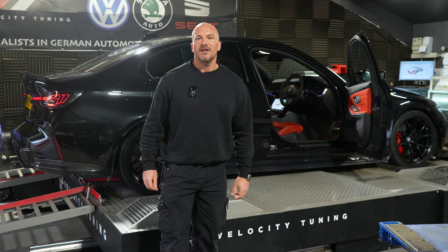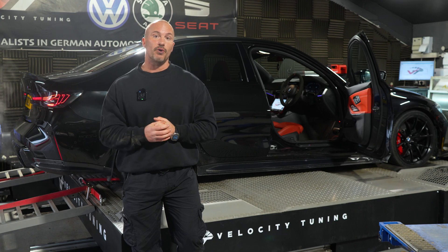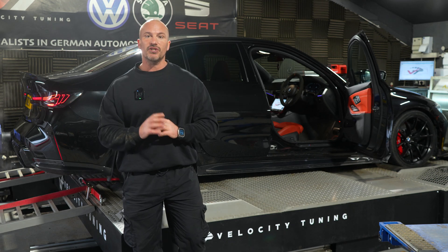Also, this will give us an increase in power without making any changes on the ECU, but by having better fueling we can push the ignition further, and we're not going to get a drop in fuel pressure — meaning we can also run more boost if we wish, and that's how we're going to find that extra 100 brake. Back over to the big PC now to start the meth mapping. We're going to use map one and copy it into map slot two, then make a couple of changes — increase boost slightly, give it a little more ignition, keep the fuel target where it is, and turn down the fuel scaler on the DI system because we'll be getting a ton more fuel coming in from the meth system. Map slot one will make 800 to 1,000 brake using 99 or ethanol or a combination — map slot two, which we're now on, is reserved for 99 plus meth.